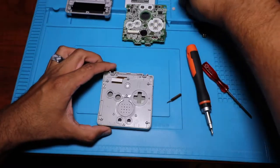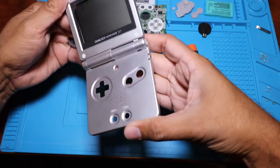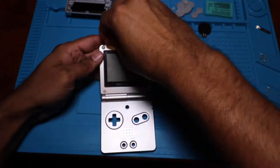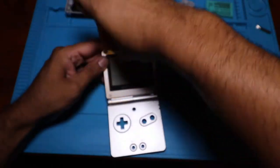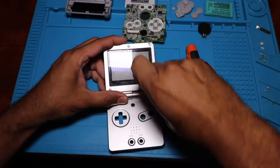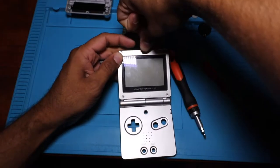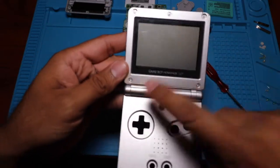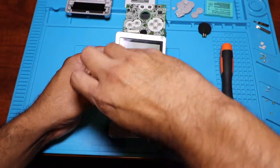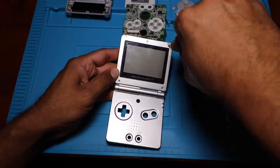If you are just cleaning up the Game Boy Advance SP system, you're going to want to go ahead and clean these up with some soap and water. If you're changing the case, you're going to want to remove these little rubber grommets. When you take them off, be careful so you don't scratch the screen or do any damage to it. It takes a little bit of effort to get these out, but don't worry if you damage them — if you have a new case, it should come with new ones. The screws behind these grommets are going to be for the tri-wing screwdriver, and once I get those removed, I'll go ahead and continue. Can't stress enough — be careful with the screen, you don't want to damage or scratch it at all.